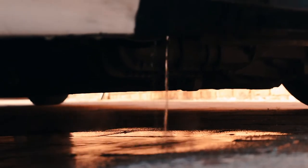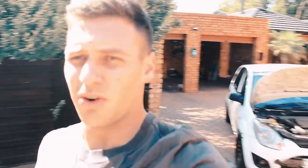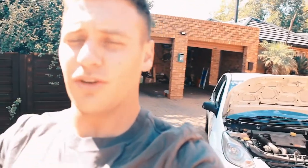Okay guys, just one tip as well: don't make the same mistake as I did and run water in your car. Use coolant because it will definitely mess up your cooling system, especially your water pump. Recommended by Ford — always use coolant. Lesson learned for the future.